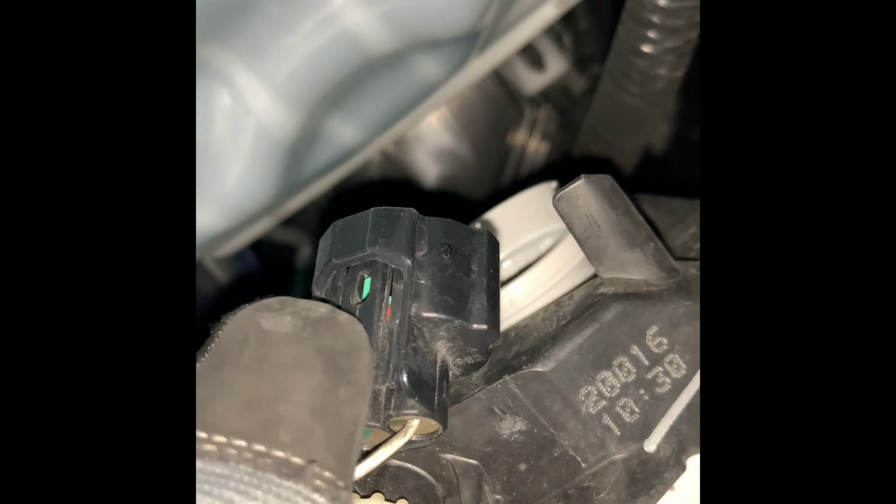Boom. All right. So there's 2 screws you gotta remove. One right here, and then this one here. This, of course, is tucked away. And then once you remove those 2 screws, we're able to reach up. There it is. So you have to remove this clip first, and you do that by pushing this tab down. You push this tab down, remove it, and then you turn the bulb counterclockwise, and then it'll slide right out.